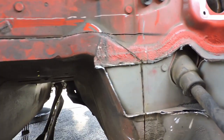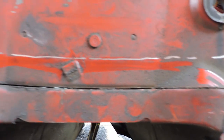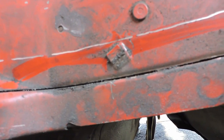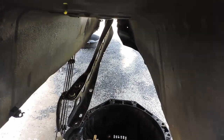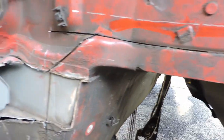But I decided not to go this high. If you don't already know, I'm following the forum on, I think it is MIATA.net. I think it was posted by Wow, W-O-W. He's the one that sort of just followed this crease, this natural crease in the body. I think I'm gonna do that for now, and if I need to take off more, I can follow this all the way up to this higher line, because I do have a T5 from a Mustang, and those top bolts are pretty nasty to get if you're ever gonna try and do a clutch change on this ever.